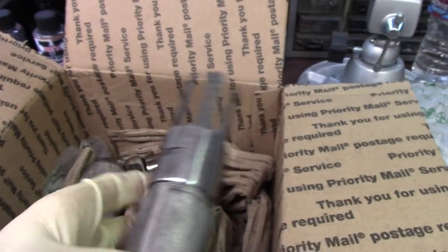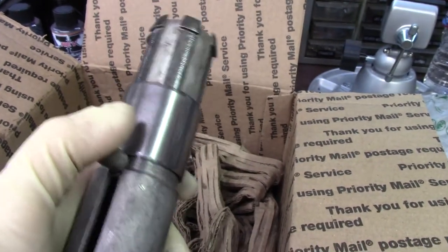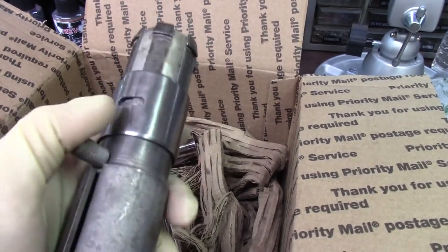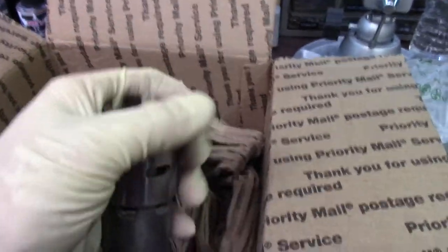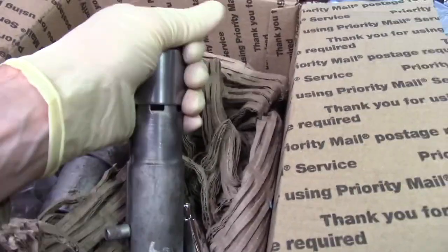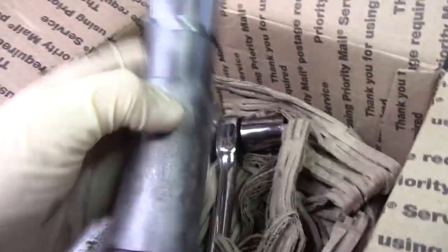So you slide it in, and then once it snaps on the other side of the bushing, you can slide this in to keep these fingers from collapsing when you go to pull it out. So that's what locks it in. So you just slide that back, and then I probably can't get this off here without using two hands, but these fingers bend very easily, obviously. So you just squeeze these in and pop this bushing off, and that's it. It comes off. So let me pop it off here.